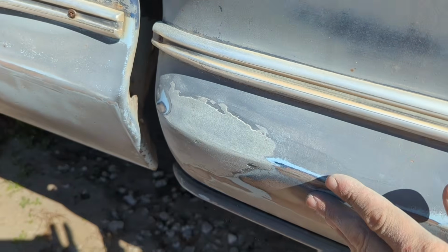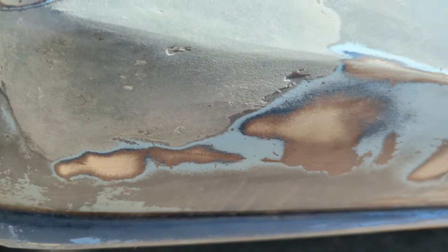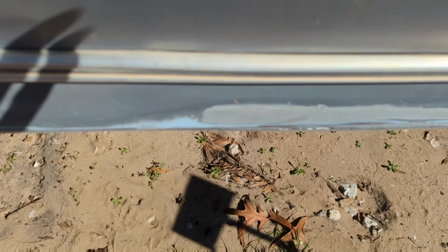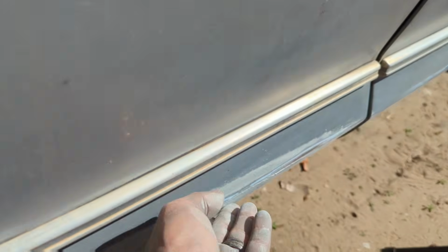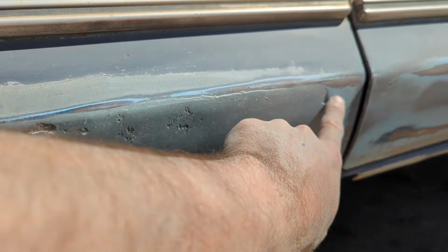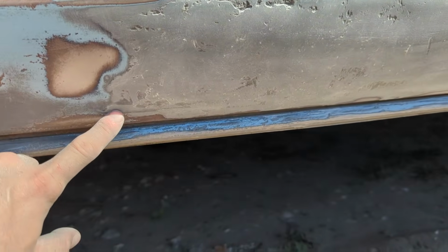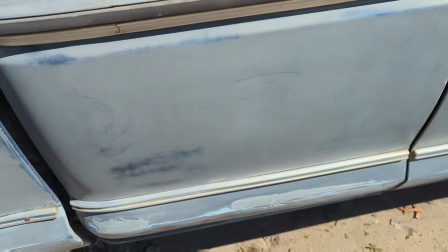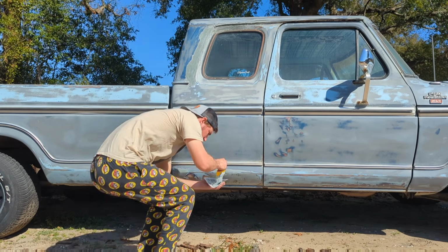Pretty good. Might be a little hard to tell, but it's pretty good straight. Good shape to it. There are some spots I need to fill. A little on the edges, mostly right here at the top at the seam. But not bad. Stick a little bit of filler on that. That'll look good. Take some regular body filler, try and fill in our little pinholes here.